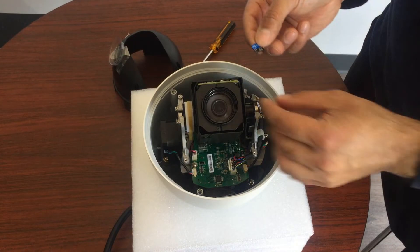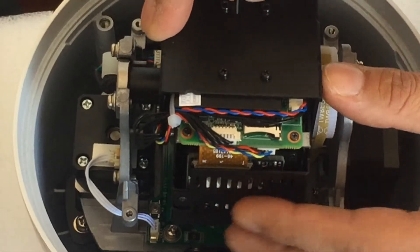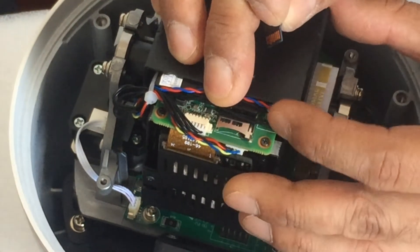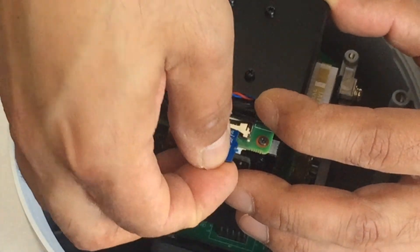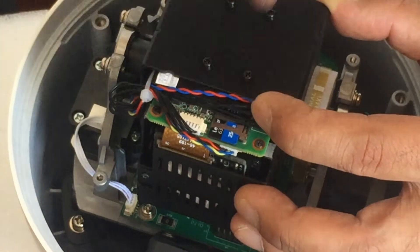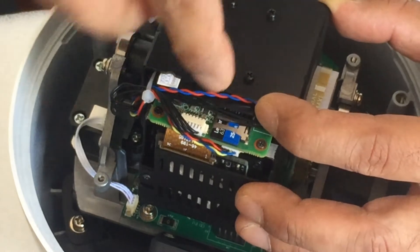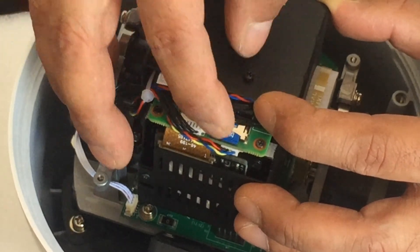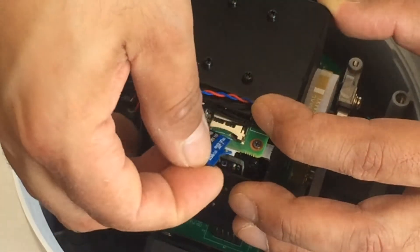I already have my microSD ready and you want to put it into this slot right here. That slot is really tricky. There are all different kinds of mechanisms on these, but this mechanism has a little button for you to release it. Obviously this mechanism is not meant for you to be toggling with all the time. When I put it in with the printed surface of the microSD facing up, it went in without any resistance and there's a clip mechanism that made a little click. I pushed it in and it released it.